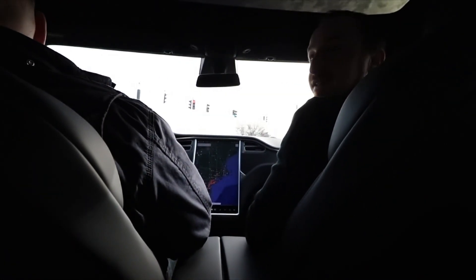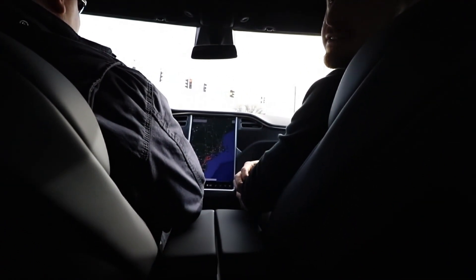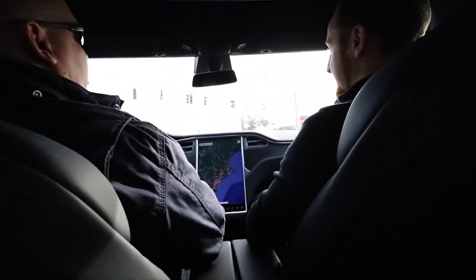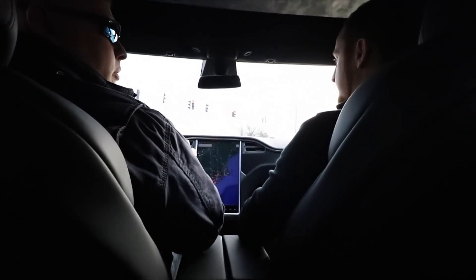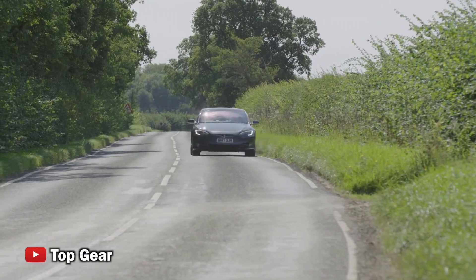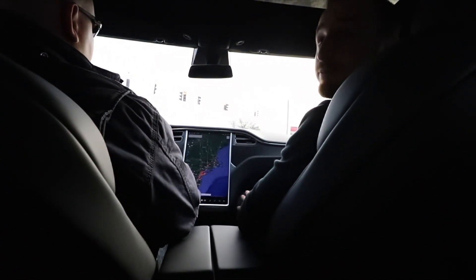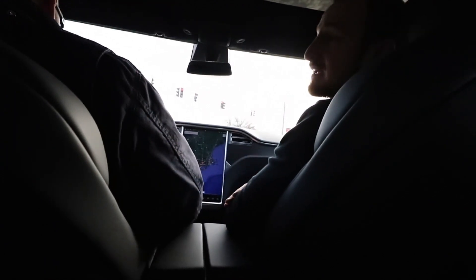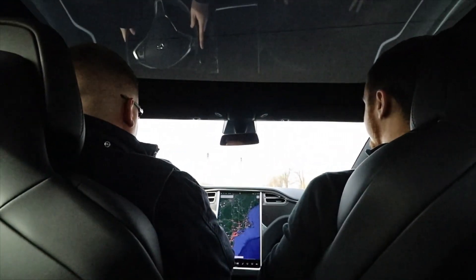As far as inspection goes, you still need a state inspection, but it's not an emissions inspection — so it's like ten bucks. Wow, it's saving you money on everything. There's no emissions. And there's a charging station you put in your house — it's a wall connector, so you get a 240-volt line installed in your house. Most people do install it. You could use a 110, and depending on how far you drive every day — if you drive ten miles a day, you could charge up overnight, no problem.